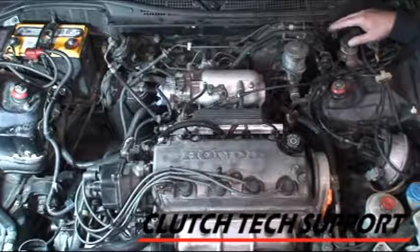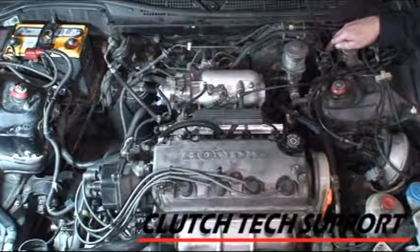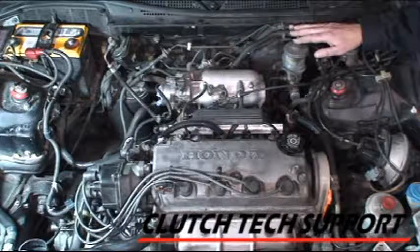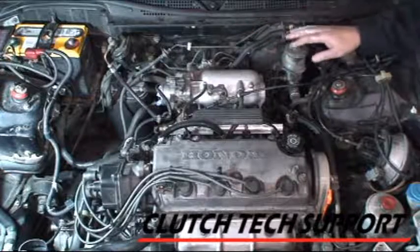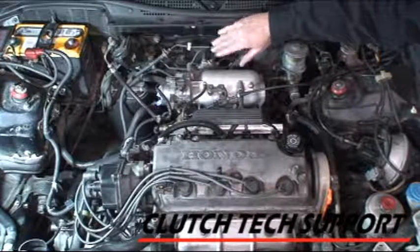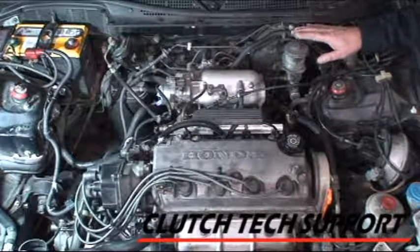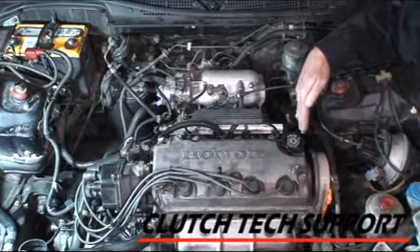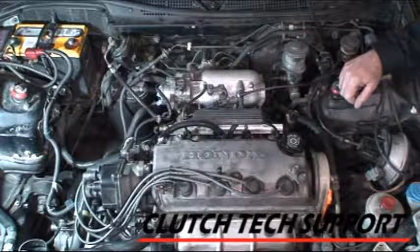The routing of this line comes out of the master cylinder, goes up well above the elevation of the master cylinder itself, and goes across the firewall. This area, along with the section over the top of the transaxle, are air traps. When a bubble gets in there, you've really got to have some action to flush it out. Those air bubbles are just going to stay there, moving back and forth as you work on bleeding this system. Watch out for this on vehicles with the slave cylinder on the passenger side. A lot of other front-wheel drives have the transaxle on the driver's side — a lot shorter line, a lot simpler.